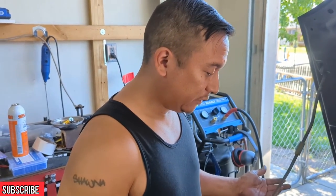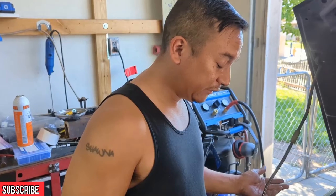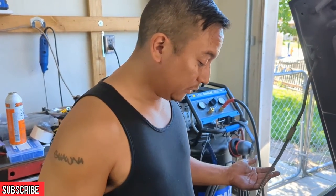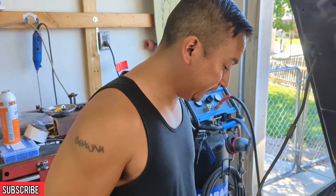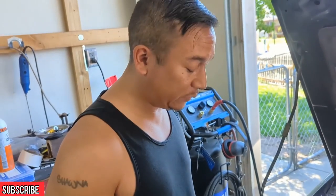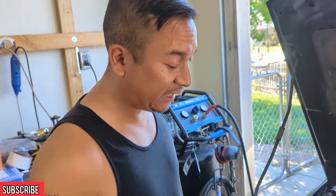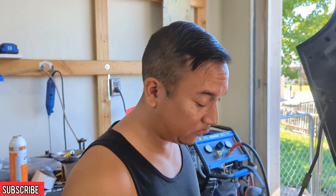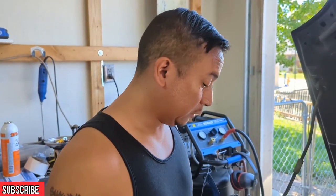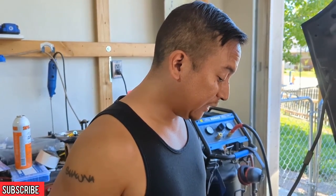Give or take? Yeah. I think NGK will tell you an aluminum block, 14 and a half. Okay. So, as long as it's within that range, it's fine. You just don't want to over-torque them or not torque them at all. Right. You don't want your spark plug backing out. Definitely not. And you don't want your spark plug to break off and get stuck in that well. Oh, yeah, that'd be a nightmare. I don't even know how you would go about that. Yeah, it wouldn't be fun.